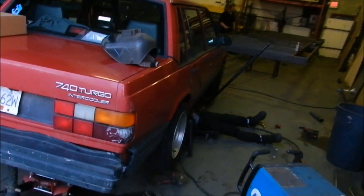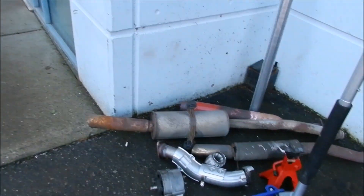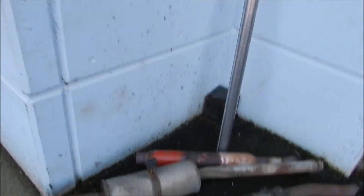What's up guys, it's Drifts and Lifts here. Today I'm hanging out with my boy Aaron Glendon - he's got his 740 up on jack stands making a nice side pipe for it. That's what we're going to be doing on Miss Huff as well. As you can see I've got a bunch of exhaust stuff - a cherry bomb muffler and exhaust tubing, all 2.5 inch. That's what we're gonna make the whole exhaust out of.